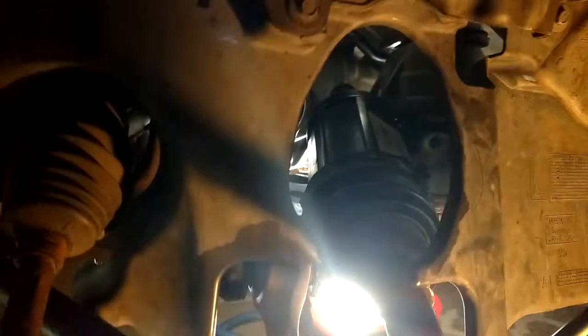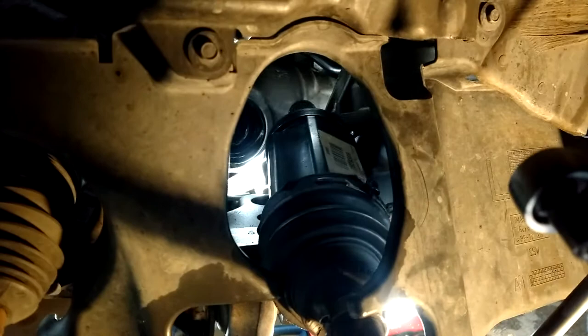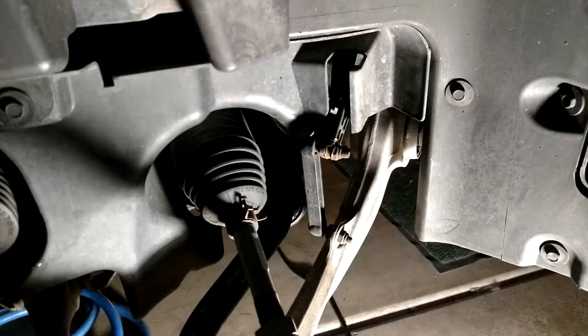Free and clear. It's resting on the motor mount which is probably going to have to come out, so I'm probably going to have to wiggle things around a little bit. But all I had to do was disconnect the pinch bolt on the hub and drop it without doing all the suspension and other stuff.